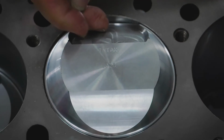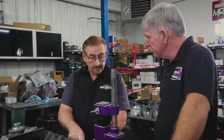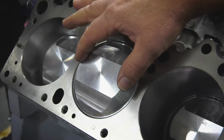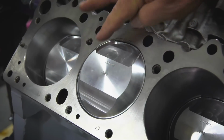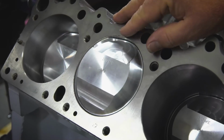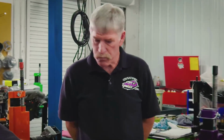The combustion chamber. But if it didn't have this cut and this cut, then the valves would just punch holes in the pistons, right? So they figured it out that if this is the finish height of the piston when it's all done, and the heads are the stock CCs, and you cut this right here, it gives you the end compression ratio of 10.5 to 1, which is a lot sexier looking piston, by the way.